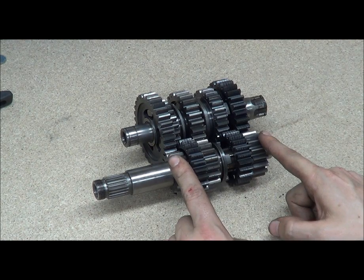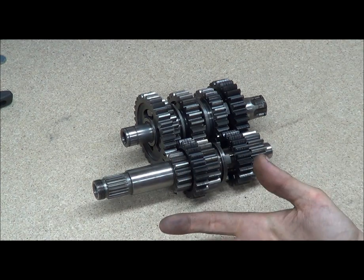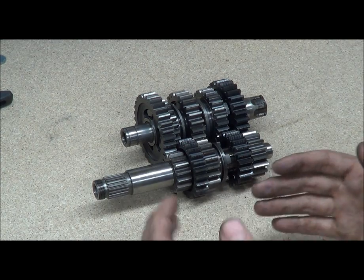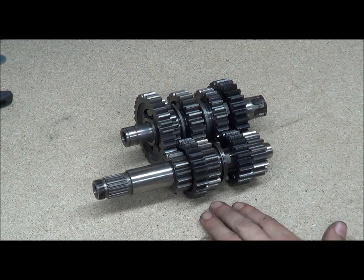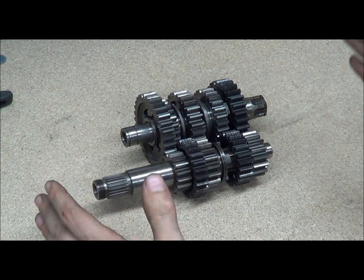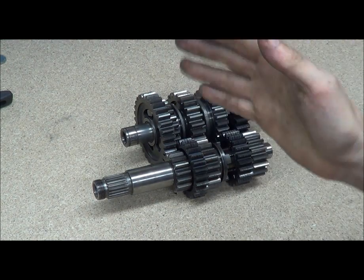So you are first, second, third, fourth, and fifth. It seems like a weird arrangement, but it's basically just to distribute the force. You'd ride around more in first, second, and third because you're stopping and starting — especially city riding. So if we had first, second, third all at one end, what would happen is there's always force going through one end of the gearbox and not the other, and you'd start to warp out your bearings. So it's trying to distribute the force around the box so the shaft isn't being driven one-sided.